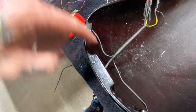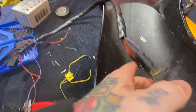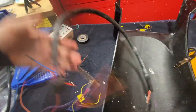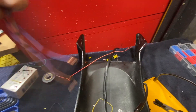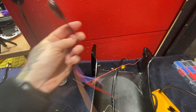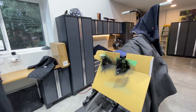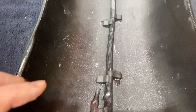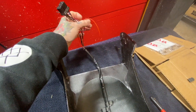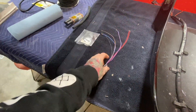I've heat shrunk the wires going from each signal and the brake light, spliced them all together and heat shrunk each individual one. Now I'm going to run the sleeve over it and start mounting a channel so this harness can make its way all the way to the front side of the fender. Then we're going to wire the load equalizer on this side because that's going underneath the seat. Got all the wiring done — mounted these clips here, just epoxied them down to hold that wire centered.